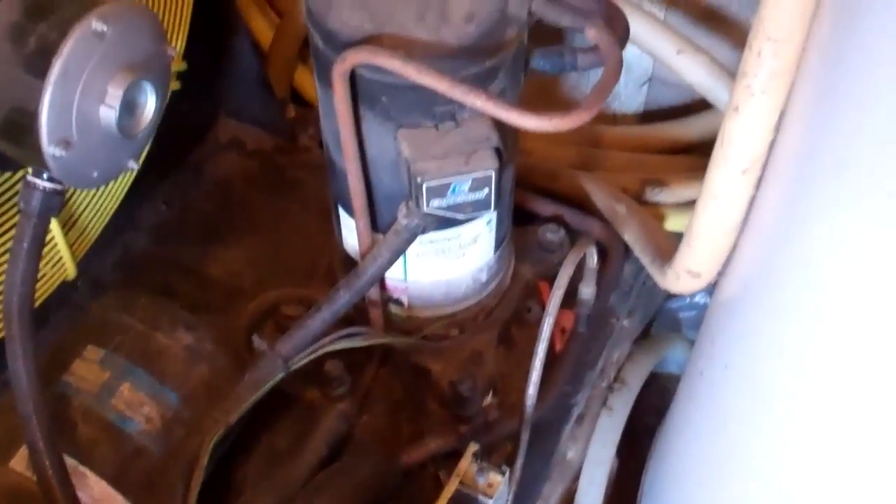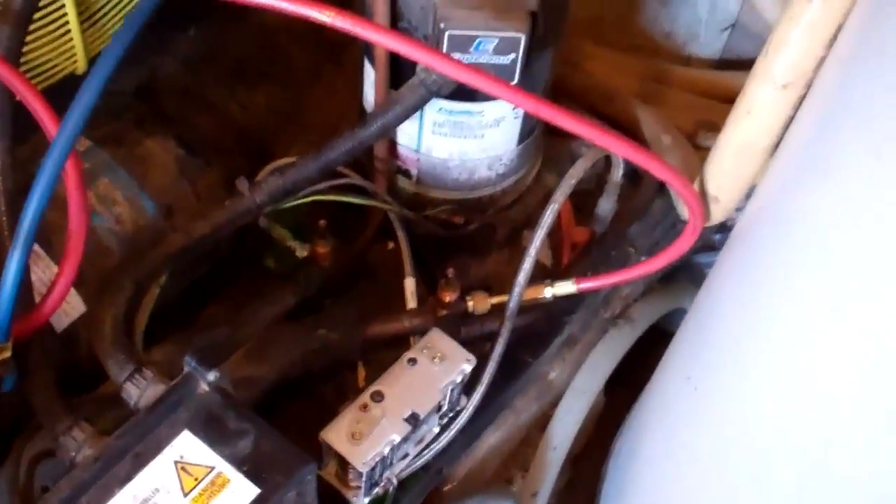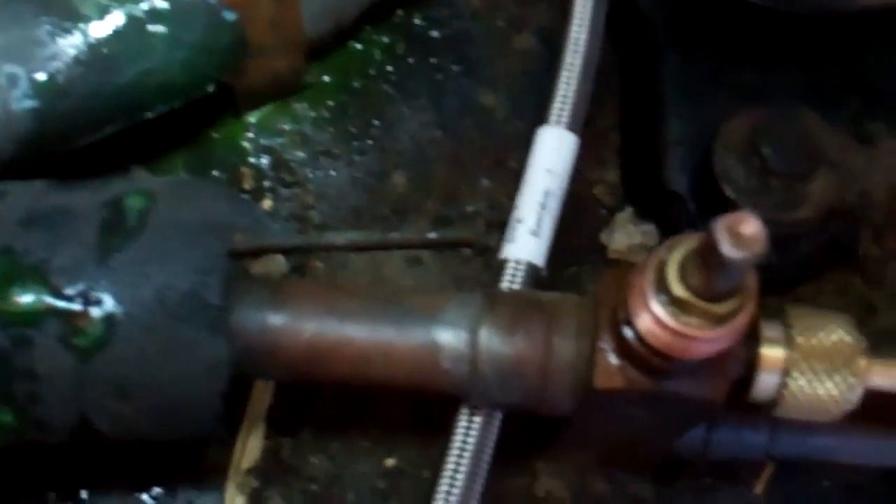Let's see what we've got on the van. If we haven't got a dual, we could put another single one in as a standalone, but there's not a lot of space — we'd be better off with a dual one. We've got our new LP/HP switch fitted and I ended up putting a new hose on the high side because it had rubbed through where it goes under the suction line.